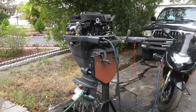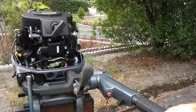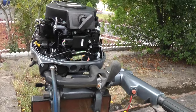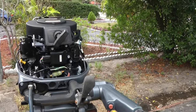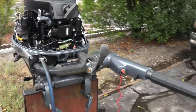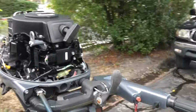After hooking up the carburetor back into the engine, the engine runs great and the throttle response is a lot better than it was before. If you remember, with the old jets that came from the factory, when I gave it throttle it would die out on me. Now, with the jets from the 50 horsepower Yamaha 2-stroke, it runs a lot better.